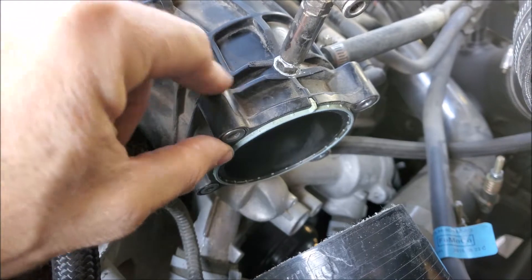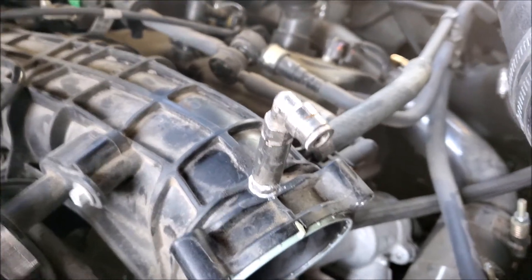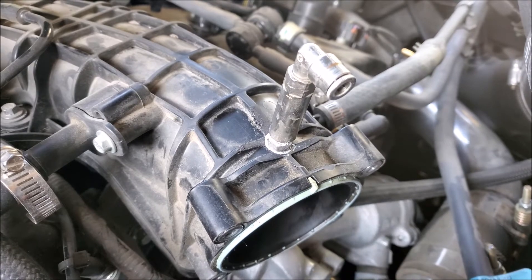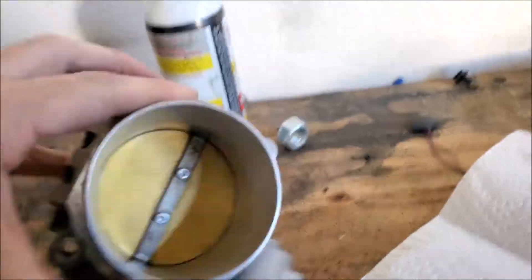The plastic is as thick as the threads are long on the nozzle itself, so I ended up having to sand down the supports a little bit so I could thread it all the way in. You can slightly see it just barely poking through — it's basically the perfect length down into the intake track. It's not too far back that the methanol won't have time to mix with the air.